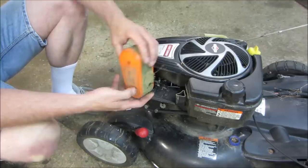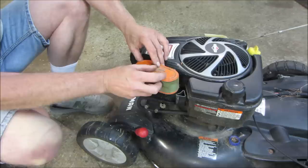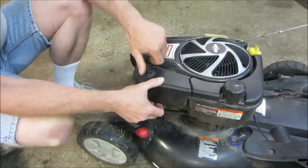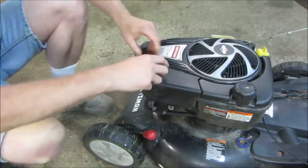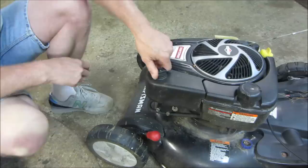The filter is dry. Let's put it outside. We'll leave it as it is. I'll put a clamp on it. We'll let it run. We'll see what it does over time. And let's just reconfirm what its issue is. The very first thing we'll try doing is we'll take the oil level down to where it should be and see if that makes it go away. But let's just duplicate what's happening. Make sure that we have a problem before we do anything. All right, back outside it goes.